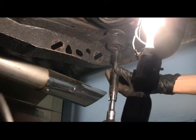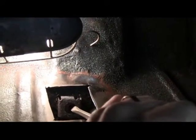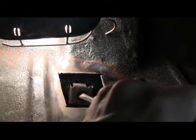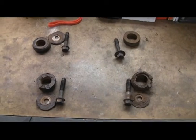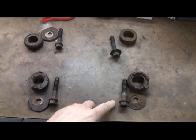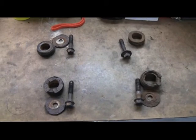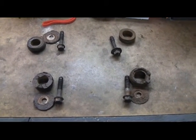All right. Let's do the other three and see how they come out. That nut floats around in that cage and that helps you position the body — and there's nothing wrong with this cage nut, which is awesome. Here are the body mounts: this is the rear and this is the one kind of midway in the trunk. They all came out pretty good. Those cage nuts are fine, nothing twisted out. Obviously, putting the heat and stuff on them to be able to get at them was a big help.